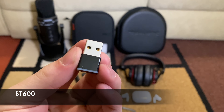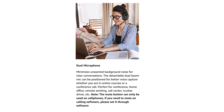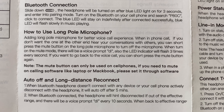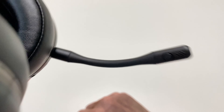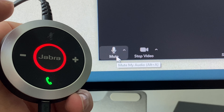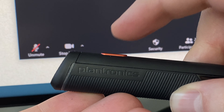I also want to mention that unlike devices from other manufacturers I've reviewed, like Jabra and Poly, using this USB receiver does not offer mute sync between the headset and the call or application you are using. This is an issue because Koozie mentions in the product advertisement that the Plus model with the USB receiver does have the mute feature available for cell phones and computers, whereas the model without the USB receiver only has muting available for cell phones. In the manual it also mentions that muting only works with cell phones, but in my testing it didn't work with anything. It does mute the sound and plays a somewhat annoying beep noise every few seconds to remind you that you're on mute, but because it's muting the sound from being transmitted, you won't get any kind of mute notifications within your software if you accidentally speak when muted. That mute doesn't sync with the mute button on your phone call or video calling software, so it can get a little confusing when you end up double muted. Other devices solve this problem by syncing the mute so that when you mute your headset, it mutes the software or vice versa.